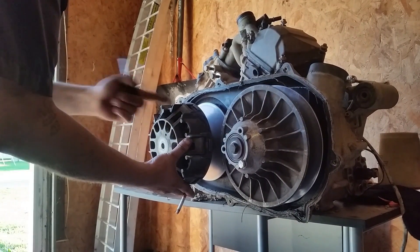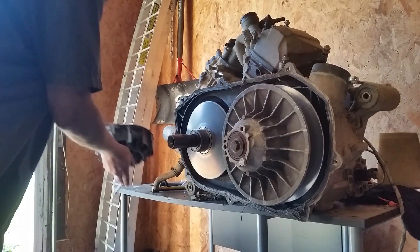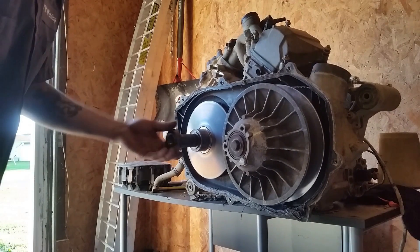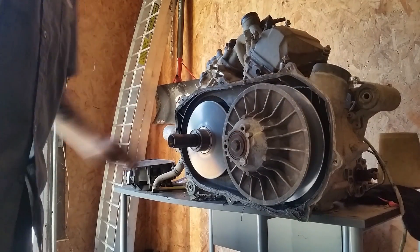If you don't do that, you'll take your bolt all the way out and then your clutch will shoot loose and go onto the ground. I don't have my spring in here, but the spring would be just behind this cap right here. This cap will have the spring in it, which in turn goes into your primary here. I just don't have the spring in there right now — I already pulled the primary apart.